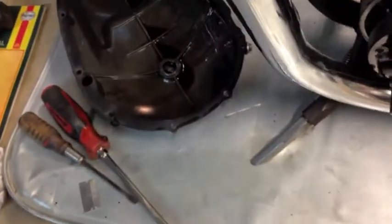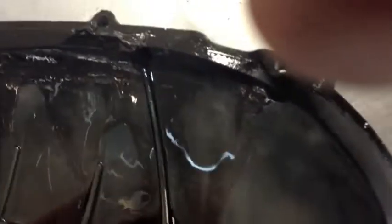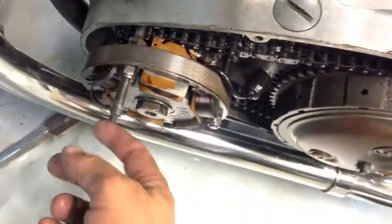So when you take these bolts off, you move it off, sometimes it gets stuck there and you pull it and it starts pulling apart. You want to save it. I think I did a pretty good job. I didn't ruin it too bad. It's still pretty usable. There's a little funky spot right there, maybe from the screwdrivers prying on it trying to get it off. And because of the magnetism, this big magnet, it's harder to get off on the front, especially off these two bolts, because the magnet wants to keep it there, so you've got to really wedge.